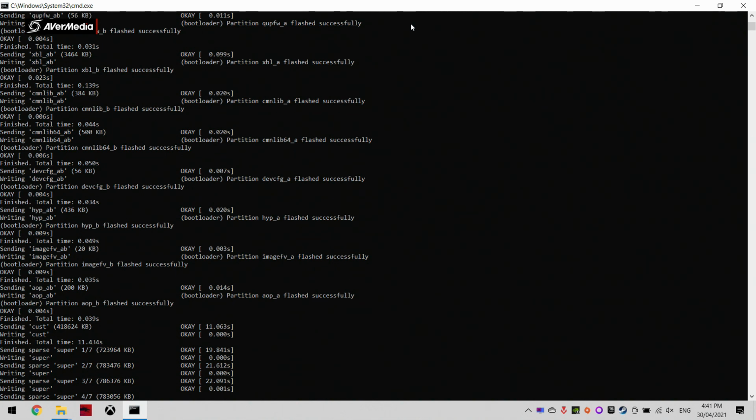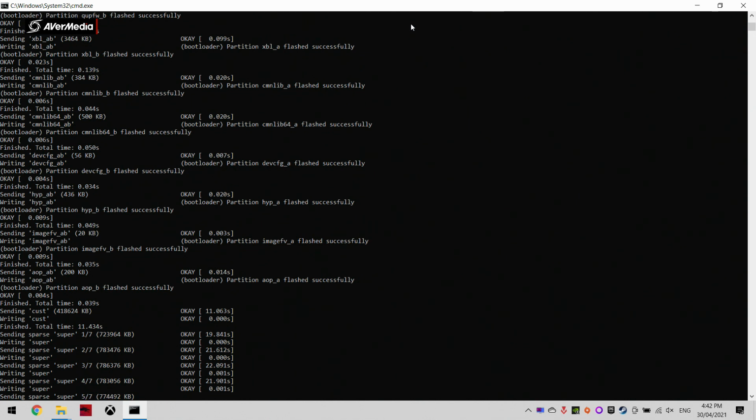The typical method that I'm used to for installing Xiaomi EU ROM is using a custom recovery. The most common custom recovery is TWRP. Usually I install TWRP, flash the recovery on the phone, and then from there I would download the Xiaomi EU ROM and copy that to the internal storage after I format the partition, and from there I could install it.